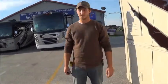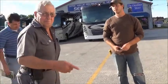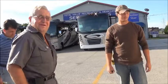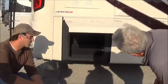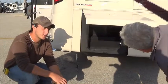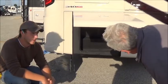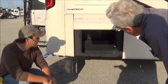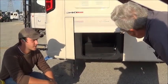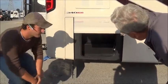The level will change when the jacks are down, so don't panic. You'd be putting hydraulic fluid in for your jacks. In here you get a little bit more storage. If you were to pick up some DEF in the one-gallon containers, this is where I'd put it. I'd keep fluids for the coach in here. You're not really going to fit a whole lot else in there — I just keep the DEF in there so it's out of the way, and the tank's right there.